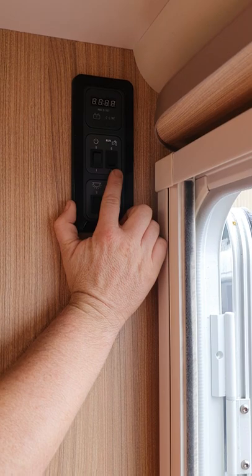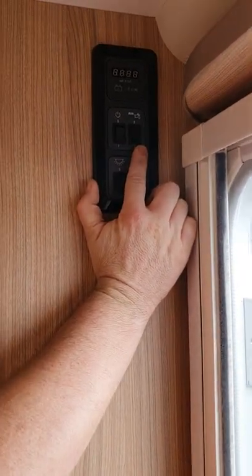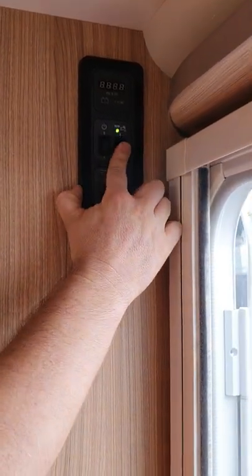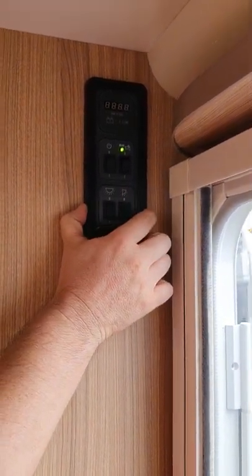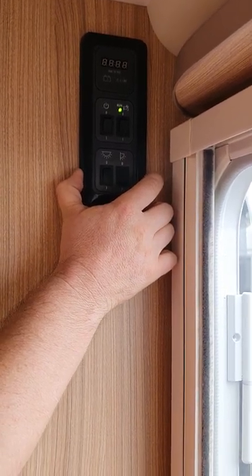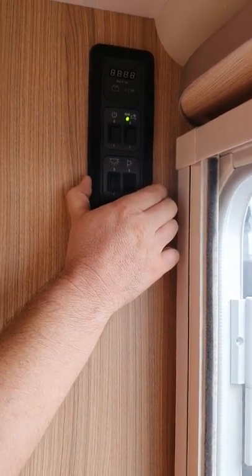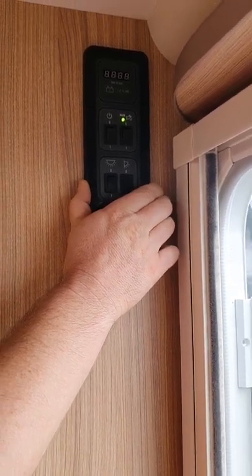This one here beside it — like I mentioned earlier — once you've hooked your water pump hose up and your water caddy's all full of water, you can then come in and turn this on, which is your water pump. That'll prime your system and you can then go and use your taps. One thing to note: if you haven't used the van for a while or you've drained water out of it, it will pump a bit of air through the line. That's quite normal — you just need to bleed that air out of the system and things should work fine.